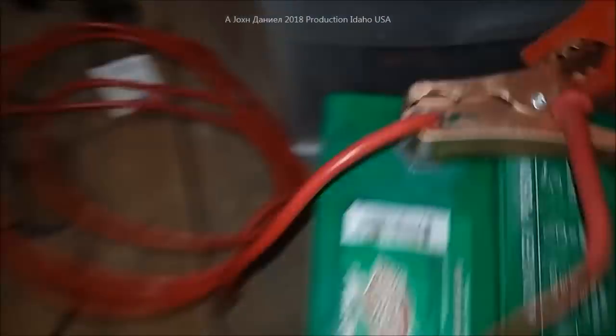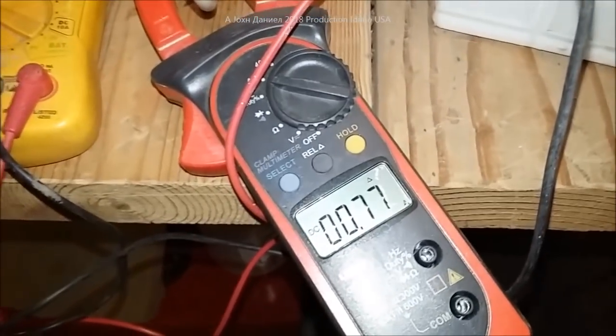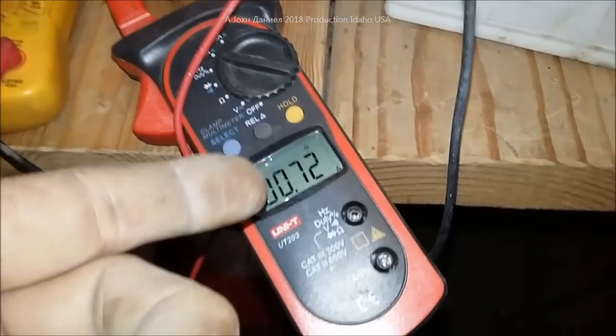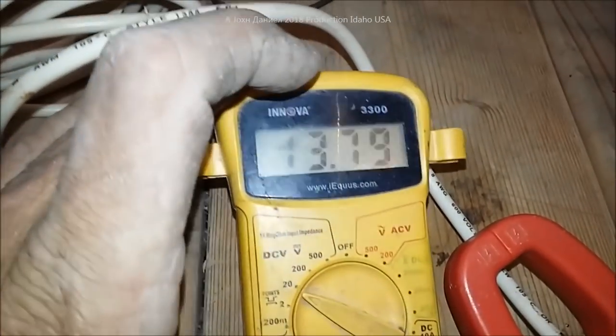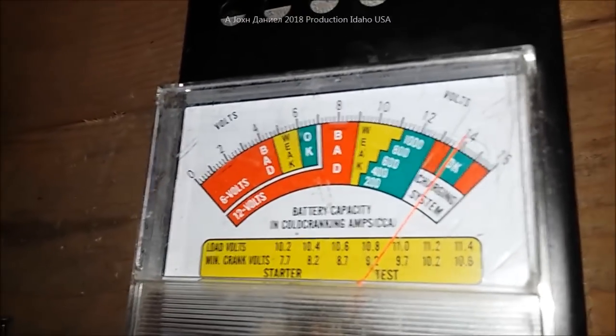All right, we're hooked up — I've got it clamped on there to make sure we get the amperage through. Right now we are trickle charging, and you can see the numbers jittering around a little bit — that's the electrolyte in the battery responding. It'll eventually drop to about a quarter of an amp. The voltage in the battery right now is going to hit about 14.1 volts and then basically sit there. If it's sitting anything higher than that, you've got problems — your converter is bad or your rectifier is fused inside.